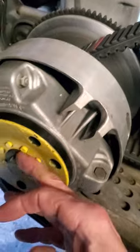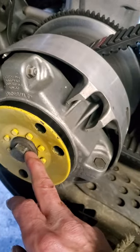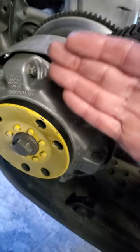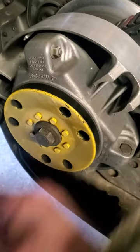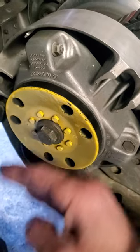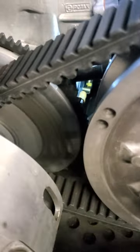That's how to do the clutch side. Let's run over to the sled and I'll show you where this is. Pull the clutch off — if you don't have a puller, look up the TRA clutch removal water trick: tilt the sled on its side, pour water in the bolt hole, wrap thread tape around the threads of the bolt and wind it in — it creates hydraulic pressure and pops it right off. The zerk cap is right in behind the clutch. Get a rubber hose on it and it's a piece of cake.